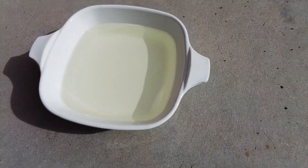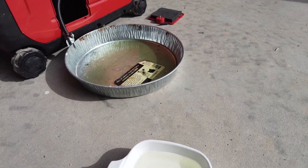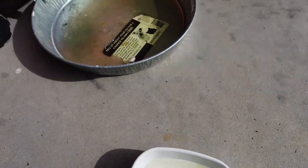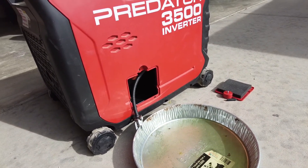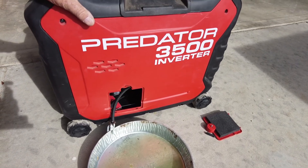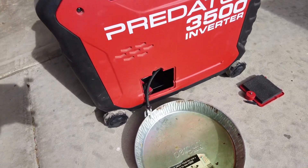This is fresh fuel — look at the difference. I think I kind of let that fuel stay in a little bit too long. This is what good fuel should look like — it's just almost clear like water. This yellow stuff, even though the generator was running fine, I think a little preventive maintenance just saved me some trouble, because I probably was about to gum up the carburetor or something. So anyway, I have all the fuel drained out of it now and I'll put in some fresh fuel and more stabilizer.